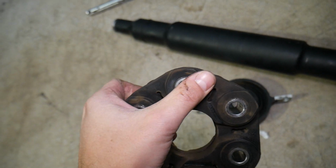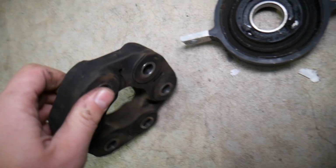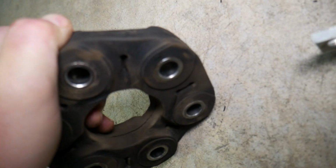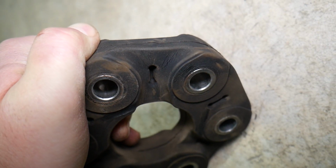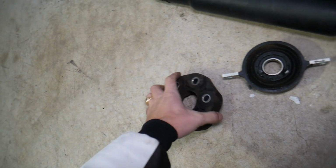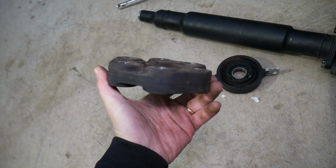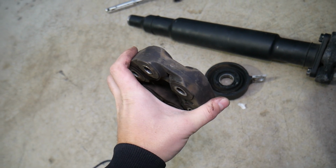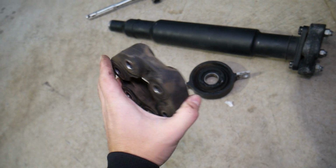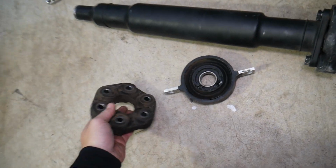You may have a rear wheel drive only, and if you look, we have microscopic cracks, but if I put it under pressure, those cracks increase, guys, they get pretty big. Those cracks mean that the guibo is not structurally strong, it's not holding really well, and as a result, it can cause vibrations. And you can feel it under acceleration when you have more power, or downshifting, that can happen as well.